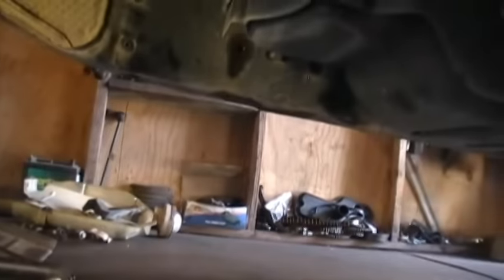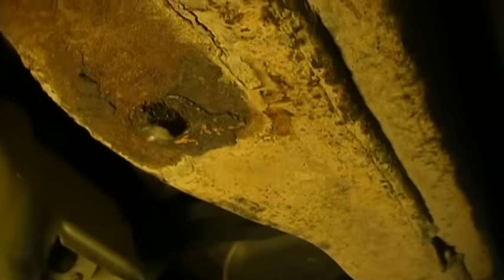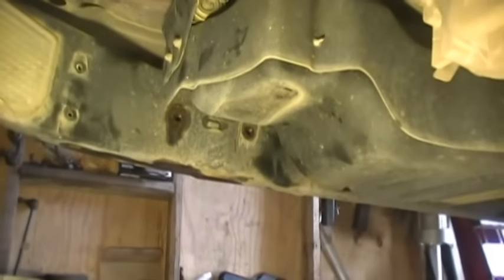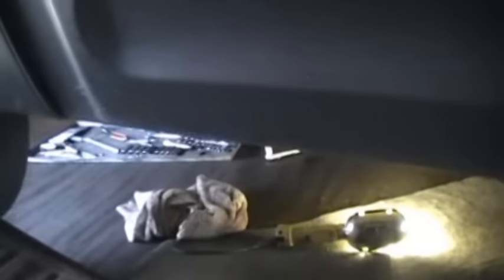It's sitting outside now. I did have one problem getting these bolts out on the frame, which all Ford Explorers are notorious about. These Ford Explorers do not want to give up the bolts on the frame — I broke three of them, twisted them off. There's one, there's two, and over there I got one bolt out but the other one broke. The bolts up on the top of the frame weren't really all that bad — I just oiled them up and let them set overnight.